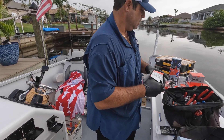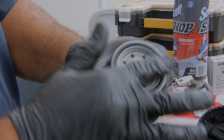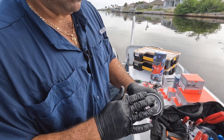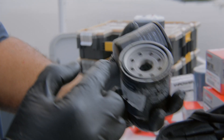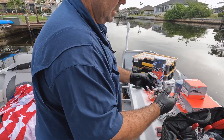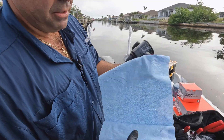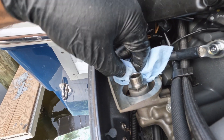What I usually do — these already have a little bit of sealant on them, but I'll give it a little bit more protectant. I always like to have a little extra. You can see how this is all rusted — it's been a long time since it was replaced. But if it's done every year it won't get close to this. I like to use 24C with Teflon, coat it, and this will let it hold up a lot better. I always wipe out the housing too — I don't want any salt getting in there.